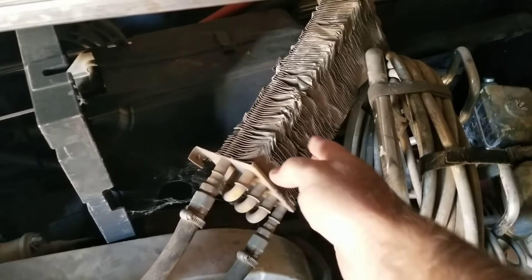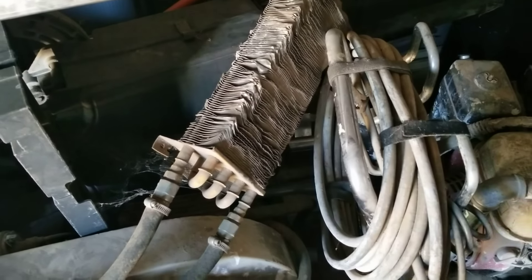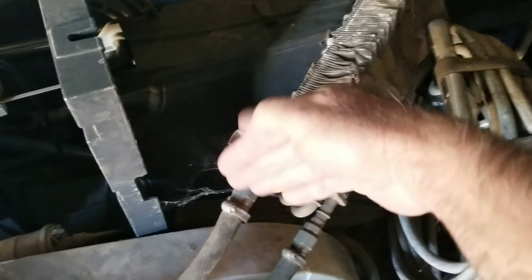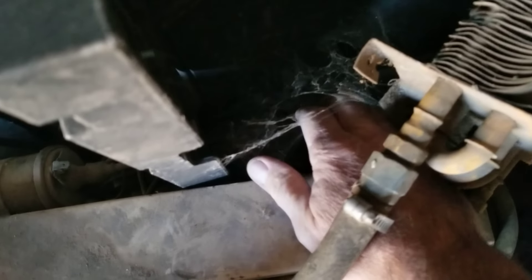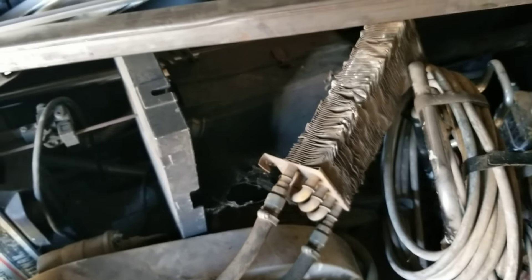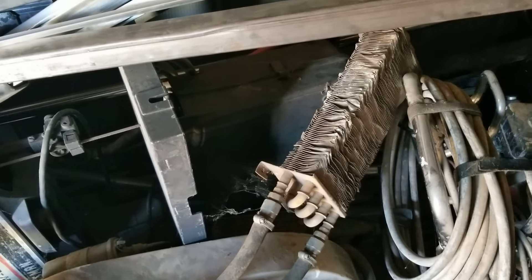If you have an oil cooler like one of these — and I know this one's pretty beat up — do not put it over the intake on your fan thinking your engine's going to run cooler. It will run much hotter than normal.